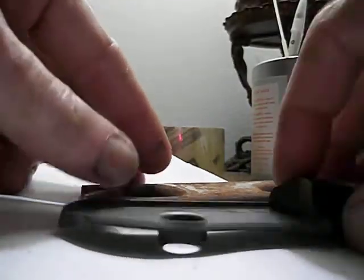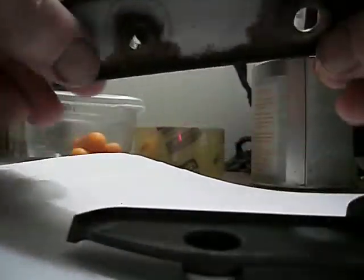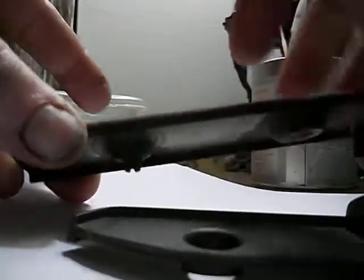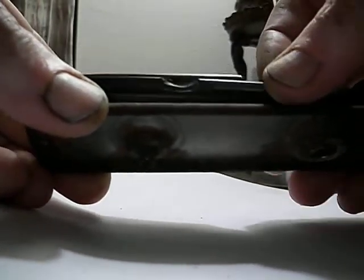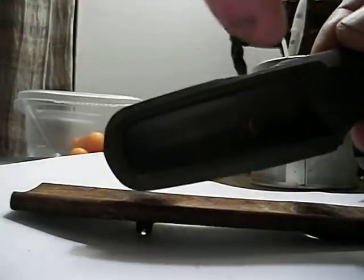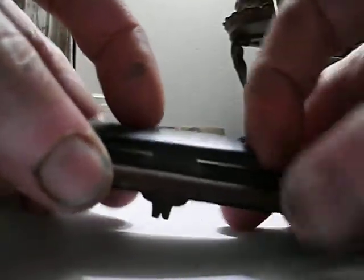The way this is attached to the car is this metal piece fits inside the door skin. I'll orient it the right way — this would be the driver's side, this is forward. This goes from the inside of the door skin. This piece would come down on the outside of the door skin, and if it hadn't broken off, it would be a little plastic peg that sticks right off of here. It engages right into that spring steel capture point, so that would go down on that like that, and that would be kind of stuck holding onto the car.